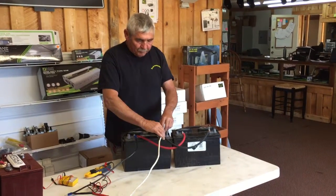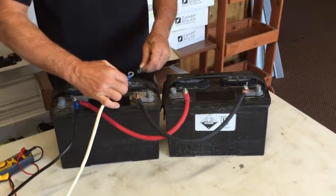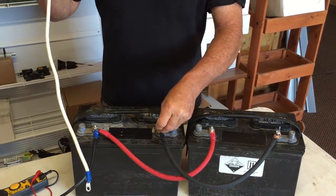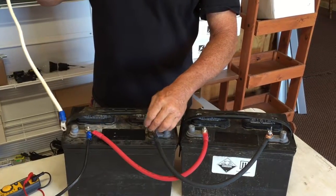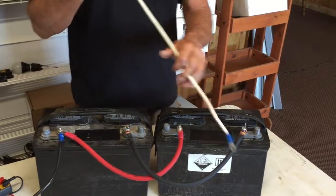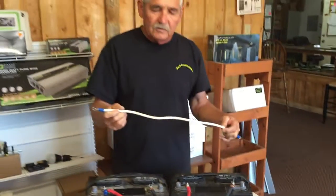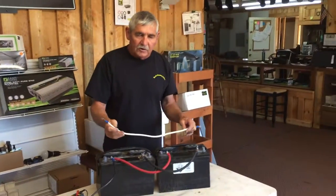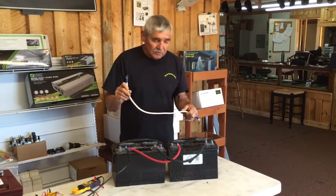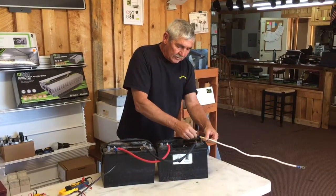To resolve this problem, you want to disconnect your negative off of this battery here. This negative is normally connected at the bottom end to the frame with the bolt that goes through the frame. You can remove that bolt and install it on the other side of the frame. Do not lengthen this cable. If you need to make it longer, take it off totally and have a longer one made for you if you're unable to do so yourself. It is not recommended to add to 12-volt cables.